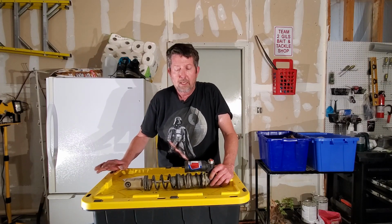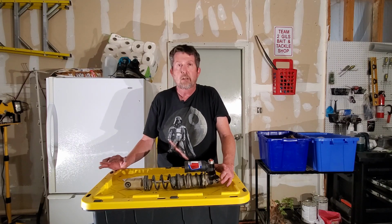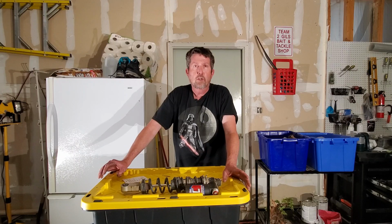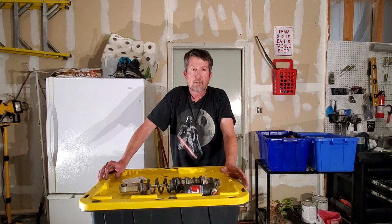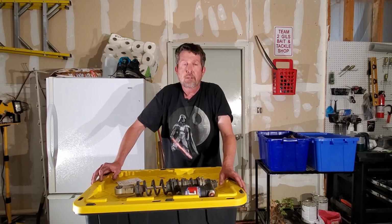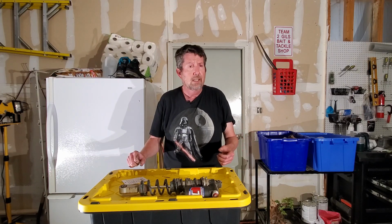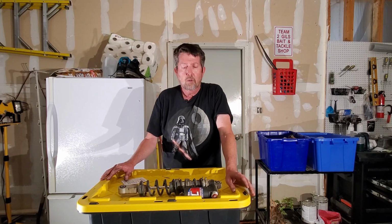Again, when you're adjusting these things, make one adjustment at a time. So start with the front, start with the rear, start with compression, start with rebound, but only one at a time. You might determine what your bike's doing first to see which one you want to start with. If something's not working at all, like maybe you're getting bucked quite a bit going off of jumps, that might be something you want to correct sooner rather than later. So maybe you want to start with that. If your bike is just bouncing everywhere, it's really rough, that's something you certainly want to tackle. So we'll go ahead and start with that.